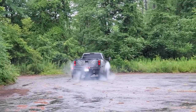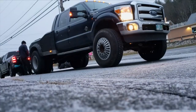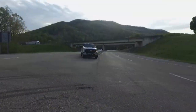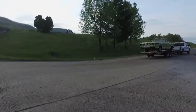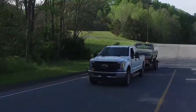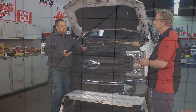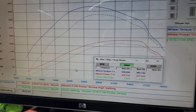Hence the name Stealth. Now, what's the difference between this module and something that would hook up under the dash? An OBD2-style tuner is going to reprogram the truck, and they really can't make much power before boost comes on. So they're doing a lot of timing and throttle sensitivity to try to get up into where boost comes, then they start dumping the fuel. They'll raise the exhaust gas temperature limits, and you can blow up your truck if you wanted to. Where ours is different, we make power by bringing that fuel pressure up to get an efficient plume out of the injectors and bring boost on earlier — we're able to give you power before boost comes in.